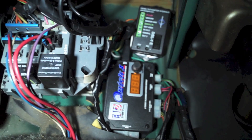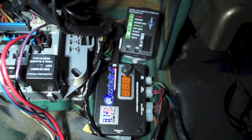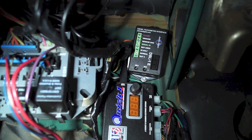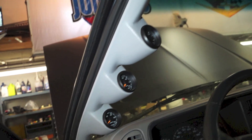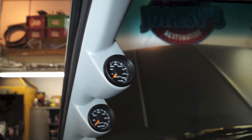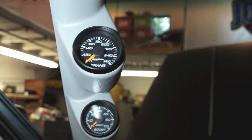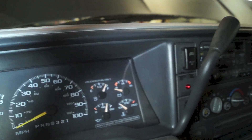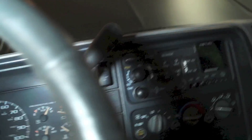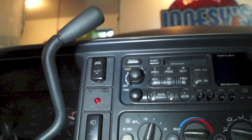It's just a very basic controller — you don't need anything fancy. Right above it is our TAC interface. We pulled the tachometer wire directly off the alternator. When you do a diesel conversion you definitely want to add in some gauges, so we went with pillar pod gauges that have a matching font to our stock instrument cluster. We also cut in and added a couple of LED light bar and fog light switches in the dash.